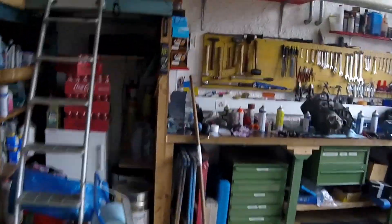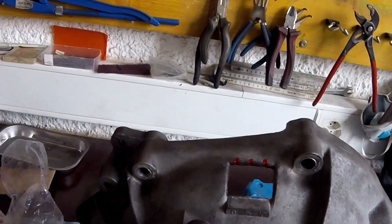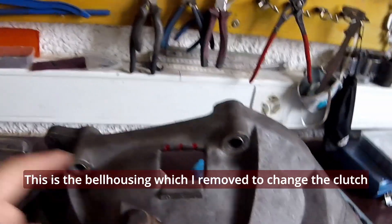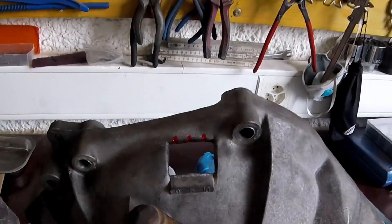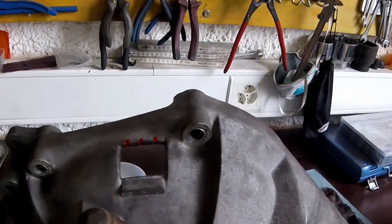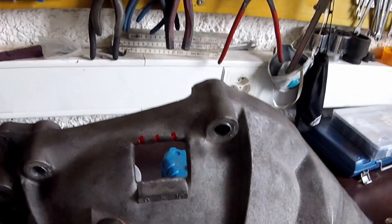Also a good idea: there's a timing mark on the flywheel marked in red, and you can see it when the flywheel turns. The timing marks are visible here, so once everything is installed I also marked everything red to get it spot on. I'm aiming for around 8 degrees before top dead center — that's something I learned from experience. I'm quite happy with that setting as there's no knocking at high revs, and it seems like a good starting point.